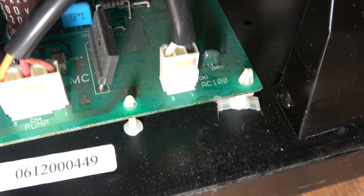The cable here does not have the same set of colours as this connector, so there may be a junction point somewhere. Let's see if they meter out though, so that they are connected. Okay, so they're all making contact, and we know we're not getting any voltages there. But this might help us work out where ground is. By far and away, the biggest amount of these areas here are all connected together and to this pin here, which is that one. Pin one of Remo. I'm sure that's ground. We've finally worked out where ground is.